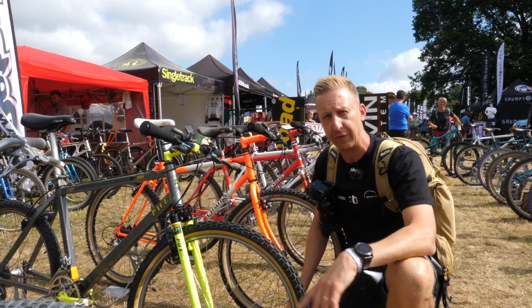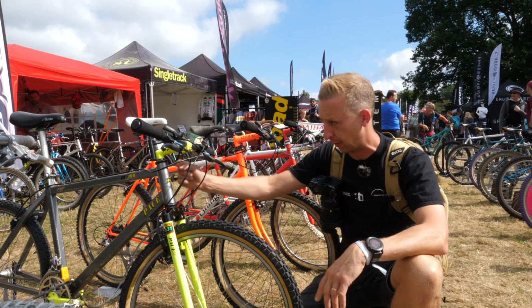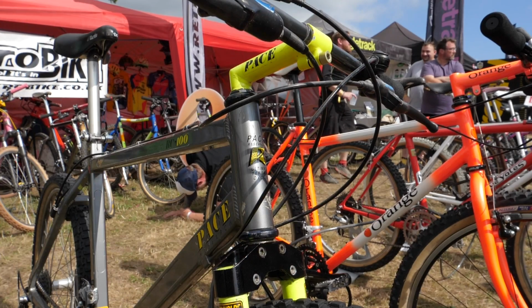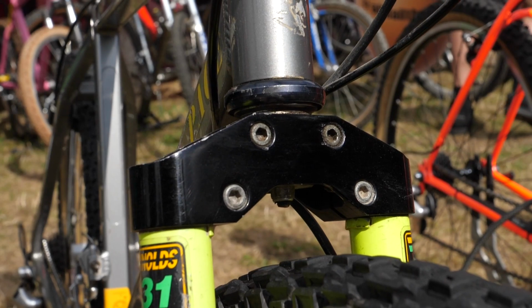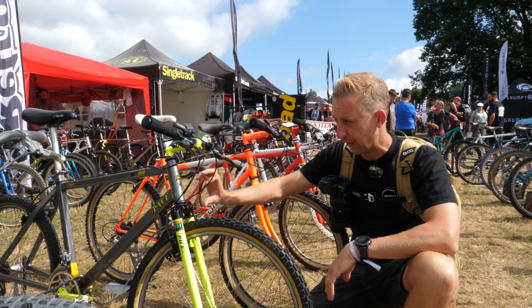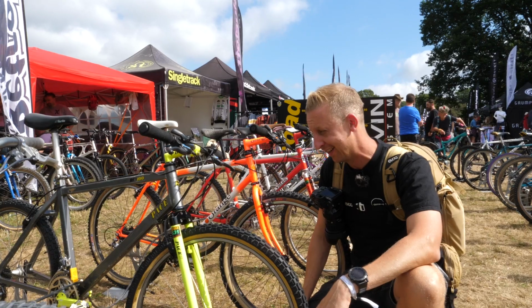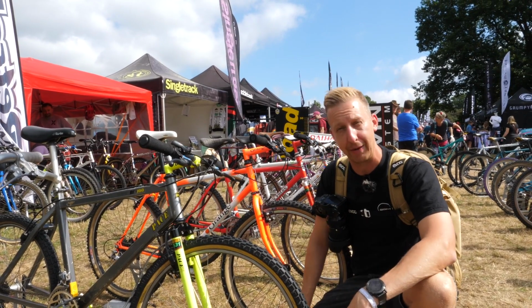So what they developed is basically what we have today, where the stem clamps on, except it's the opposite way around. The stem and the steerer tube are one piece, clamped by the fork crown there, and it's preloaded together from the bottom. So it's effectively just the other way up. But so clever that they were doing this in the early 90s. I just think it's cool and it's not shouted about enough.